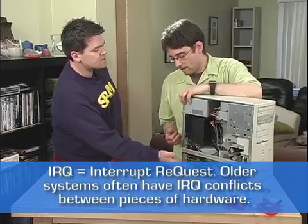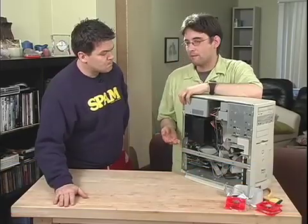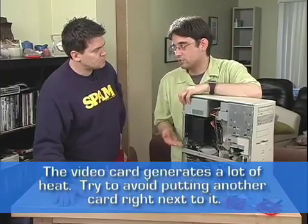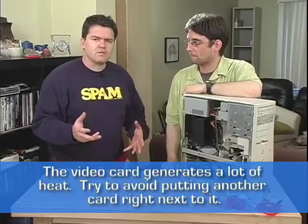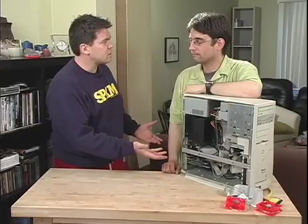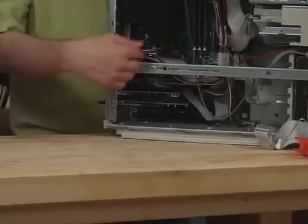Now we're talking about PCI slots here, and in next-generation machines, PCI Express slots. You may also have an AGP slot. You can't move the AGP card around, but if you've got a PCI card right next to it and you have spare slots further down, you may want to consider moving it. I'd also recommend getting rid of your fax modem — if you never make fax calls or never use your dial-up modem, take that redundant card out. There's no point keeping it in the machine, and it gives you more space and more airflow. The same goes for things like serial cables — in older machines you'll have a bracket on the back with a wire leading to the motherboard. If you don't use that, just remove it entirely from your system.